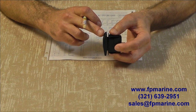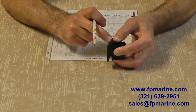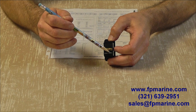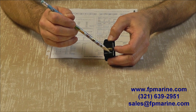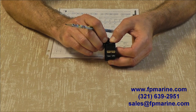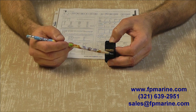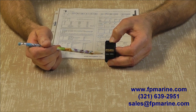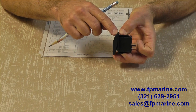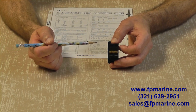When switching the actuator to position number one, you'll notice by the parentheses it's momentary. In that momentary position, terminals two and three are connected, and also terminals five and six are connected. Terminal six usually goes to a starter solenoid, which activates your starter — it's only momentary until the engine starts. Remember, this is a double pole switch, so these two sides are independent of each other. There's no danger of any back feed or interference going to your ignition circuit. The ignition circuit stays active whether it's in position two or position one. There is a jumper across here providing power to both sides of the switch, similar to the nav light switch.